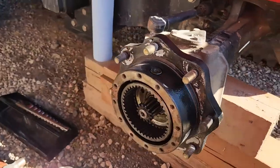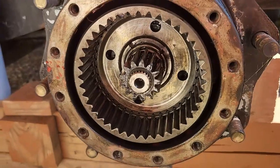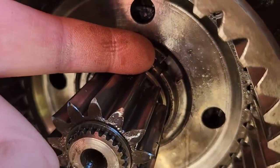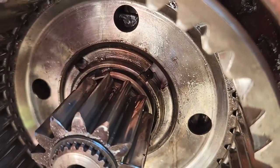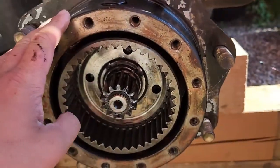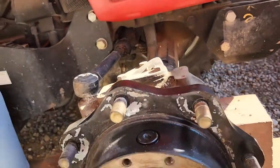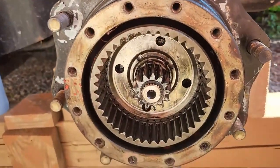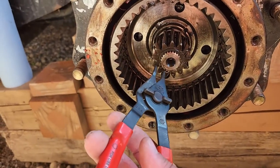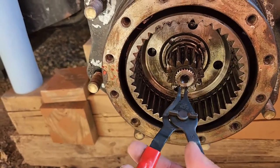Let's have a look at what's inside. So there's your typical planetary gear set setup. This nut back here you can see has a crack in it. That's fantastic, because it allowed this entire hub assembly to walk off of its bearing race and begin to ride on this steering knuckle. I'll show you later how it mushroomed over the part of the knuckle. The only thing holding this whole assembly from falling off was this snap ring - so these babies are severely underrated.